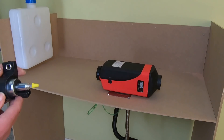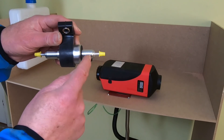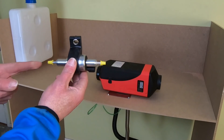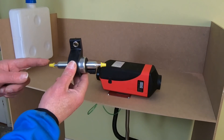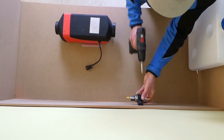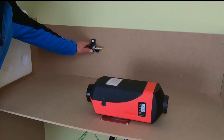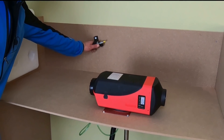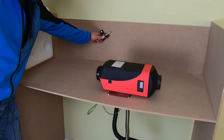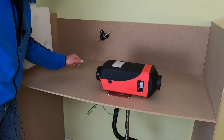Now first about this pump. If you take a good look, you see there's an arrow pointing in that direction. That means the diesel comes in here from the tank, and it goes out here to the heater. Now if you mount the pump, make sure it is up about 30 to 35 degrees. That way there won't be air bubbles in the pump mechanism.